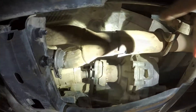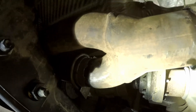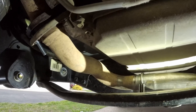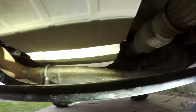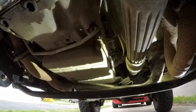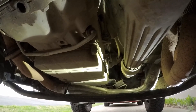Here's the Y-Pipe itself, and you cut it 10 inches in — you can see right there where the clamp is. And here's the passenger side; you cut this 5 inches in. The cut's right about there. There's a shot of the whole pipe, and I'm glad I put this in — it worked out really well.